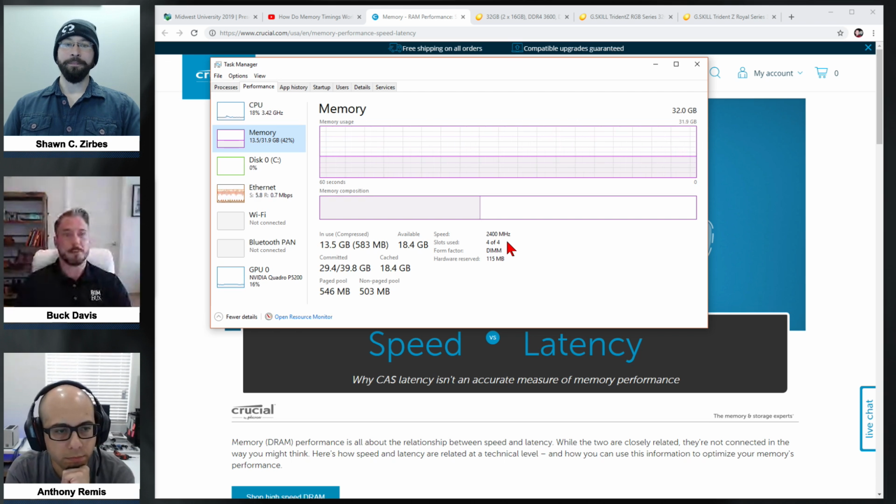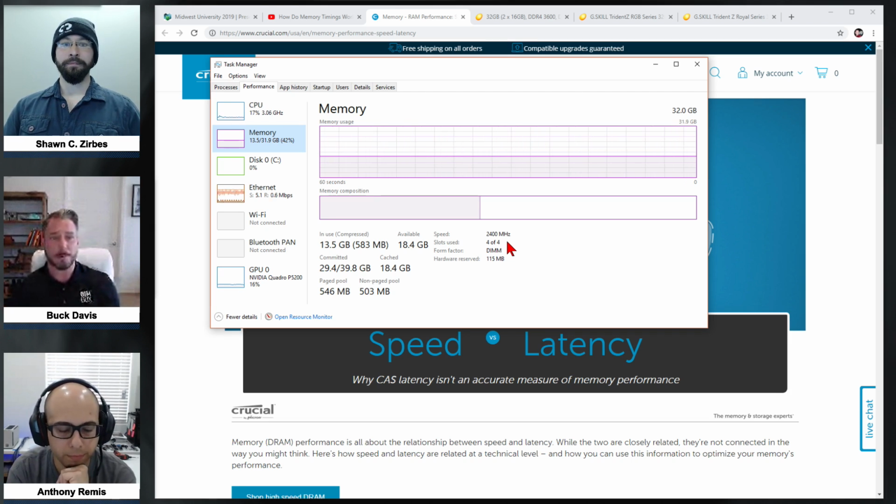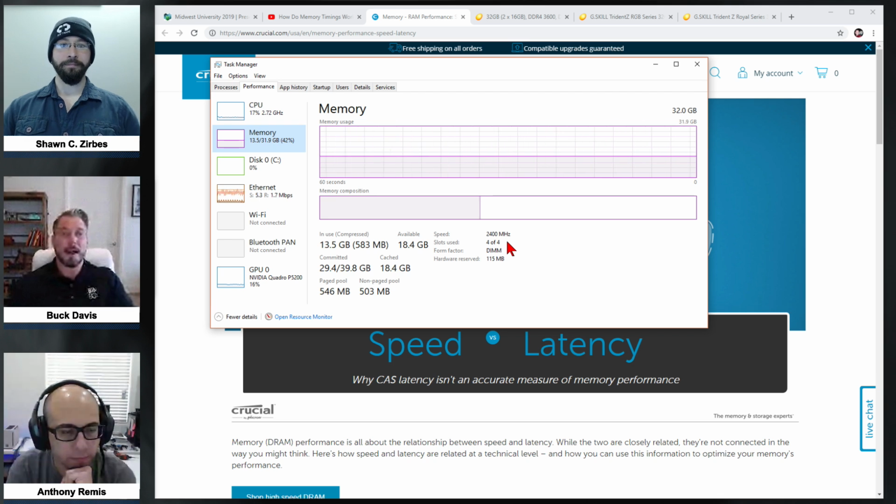So a lot of times you'll see a computer manufacturer say, oh, I got you 64 gigs of RAM, and it can hold up to 128, but you're buying a whole new kit of RAM if you want to go to 128. Whereas we try to be mindful, if it maxes out at 64, we want to leave you 2 slots to grow into. Right? And that's another thing. We might not want to get you 4,000 speed RAM if you're going to grow into a system, because you'll never find the batch RAM for it. You'll end up buying a new RAM kit anyway.